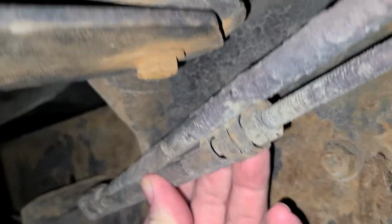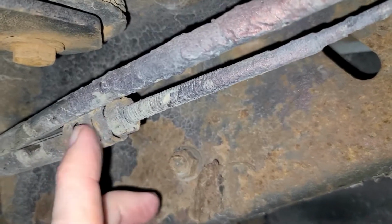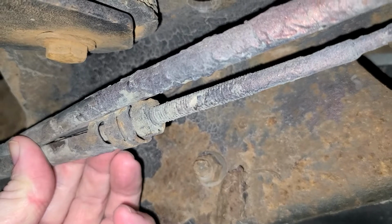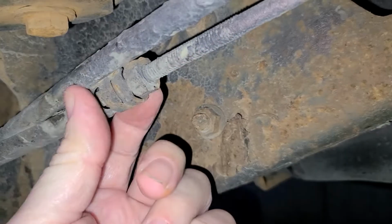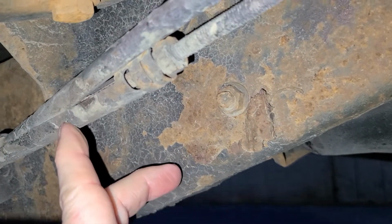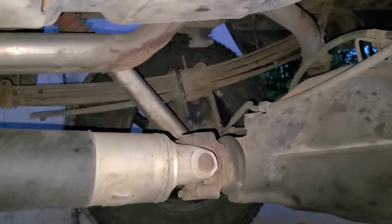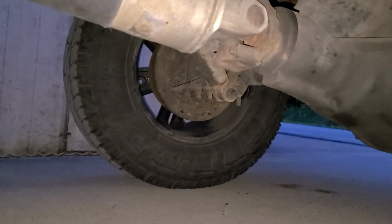But it has this bracket. It's like that little connection is just bigger, and the other cable is the passenger side cable, which is adjustable, and that's where you get some of your tension for the passenger side. So I'm assuming that once you loosen this adjustment nut up, that it's just a bigger metal clip that can slide out and slide that way and disconnect from the left parking brake cable for replacement, and that comes out of the same hole. It just goes up and over and bolts to the main axle, the differential right there, and then runs over into the drum on the passenger side.